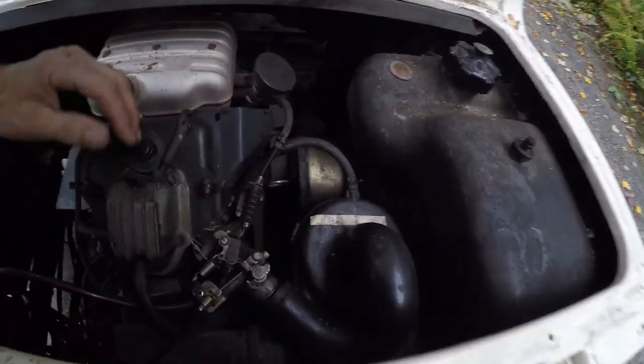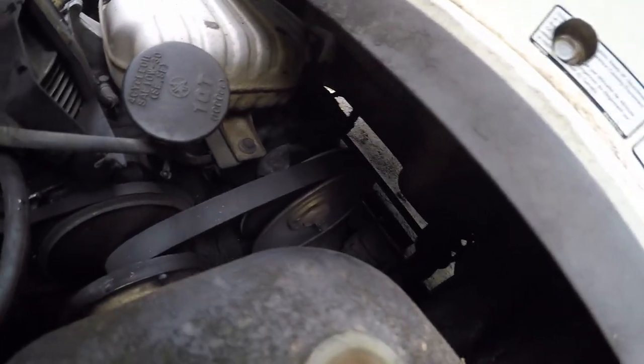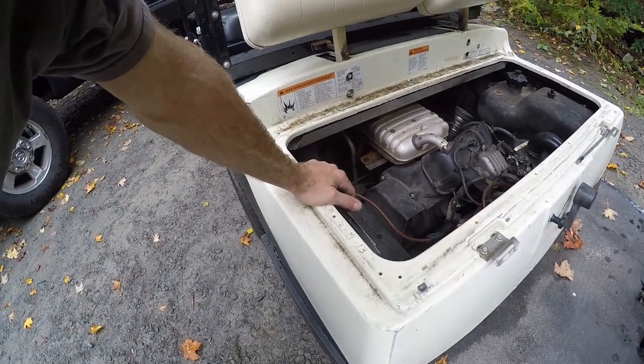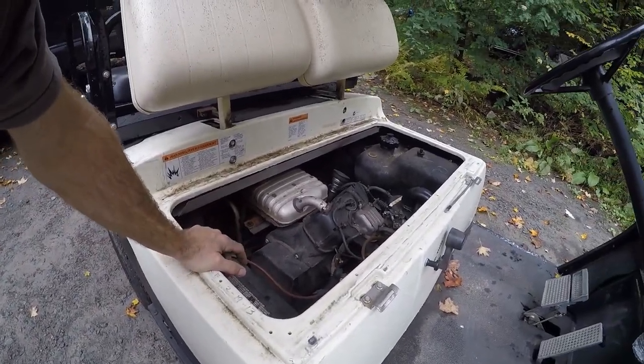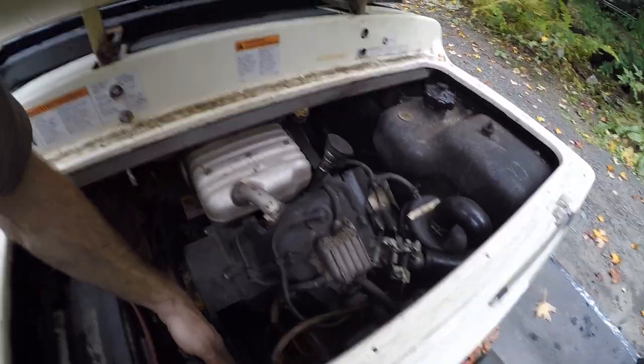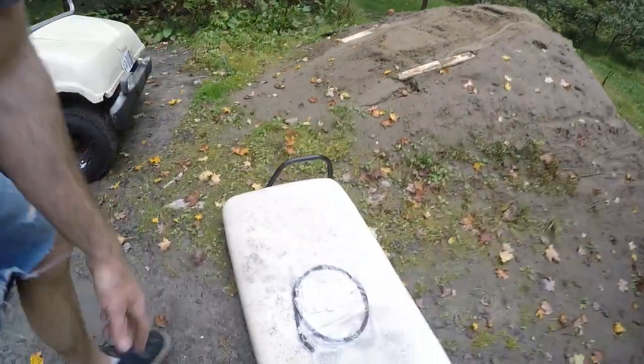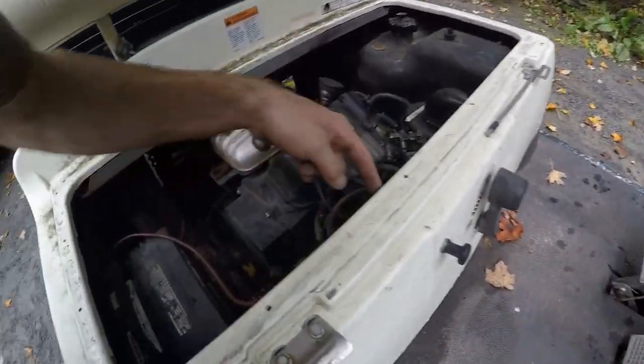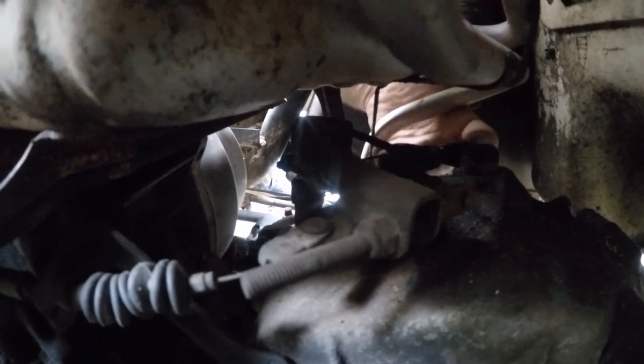When I hit the gas pedal, nothing's happening from the cable. The power turns it on for the electrical side to kick the starter — it'll turn over and turn over, but as soon as you give it a little bit of throttle, the engine fires to life. Looking through the back I can see the throttle cable moving, so that part's connected. But whatever this cable hooks to at the throttle/accelerator pedal — that part is broken.